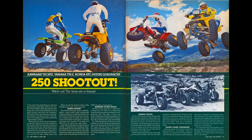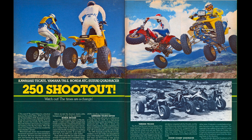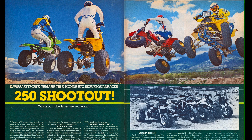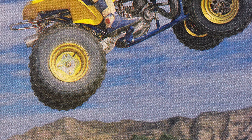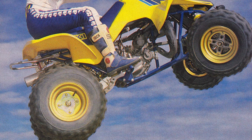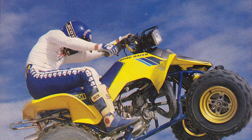With only 7.9 inches of travel and no adjustments aside from spring preload, the front shocks on the Quad Racer were painfully average performers — harsh at low speed and prone to bump steer, transmitting far more of the track to the rider's wrists than most pilots appreciated. Serious leapers showed the limits of their modest performance, and most riders considering racing would have been well advised to look at aftermarket front suspension upgrades. In the rear, the full-floater showed much better performance with a decent ride that worked well under most circumstances, and most riders could find an acceptable setting with its limited adjustments.